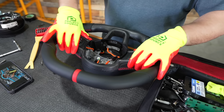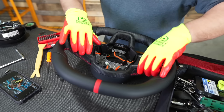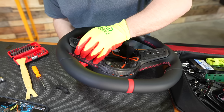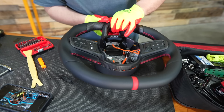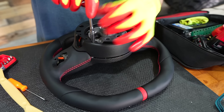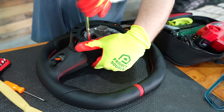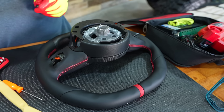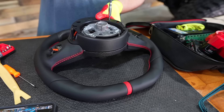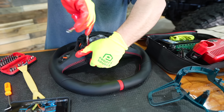We've got the steering wheel kind of put back together. I had to wire this up for the actual heated steering wheel too, which you can option. I want to make sure everything's done right, so when you're setting this on, I'm referencing all the photos that I took and making sure all of this is set into place. Here's the part where you want to go easy — you're threading these into little standoffs and this kind of suctions the whole wheel together. It's very important all your wiring is correct. Go slow; if it doesn't feel like it's going, double check all your wiring and tolerances on the inside.